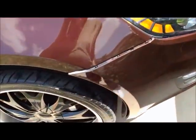all the fasteners off. Now, I don't know if I can get the camera in here, but inside here there are more bolts. I don't have a very good view because of my placement, but once I get them off, I'll show you where those bolts were. Those need to come off. You'll have to pull this back. You'll be able to reach up inside there and take the nuts off and the bolt. There's 3 on each side. Those need to come off before you pull on the bumper. Cannot stress that enough.